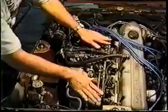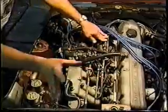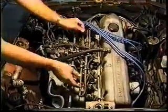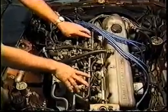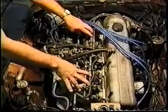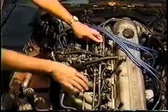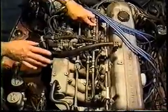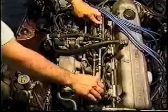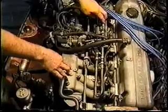Once the fuel is being injected liquid-wise, we've given it as much fuel pressure as necessary, the pump's working properly, the filter's not plugged — the system brings a good solid wall of fuel, because fuel pressure is not necessarily fuel volume. That's important to realize: you have to have both pressure and volume to make this happen. Don't get too complicated with yourself as far as how you're going to measure fuel volume or fuel pressure — some of these testing units are very expensive. Suffice it to say that if the car will start and run, you've got some fuel pressure.